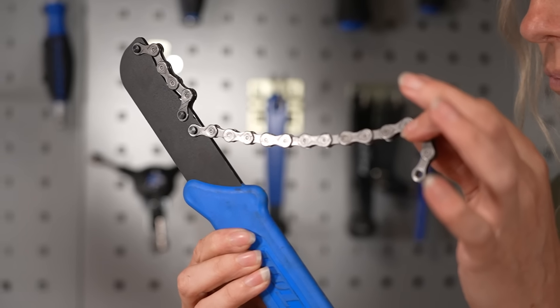This little piece of metal here is basically a lock ring that holds this entire cassette onto your freehub body on the wheel. The cassette tool just needs to fit into there, into all the teeth, and then it's an anti-clockwise, lefty-loosey motion to open it up. But as you can see, as you turn it, it will turn the cassette as well - and that's where this chain whip comes in.